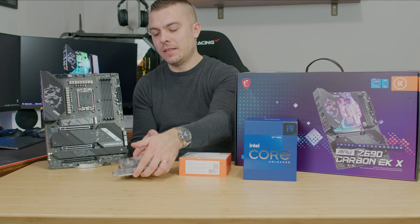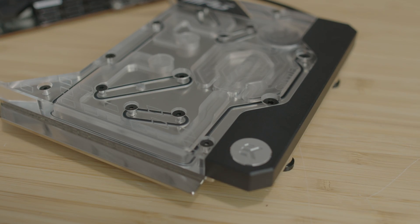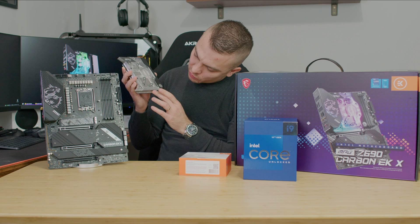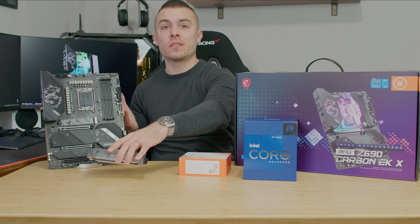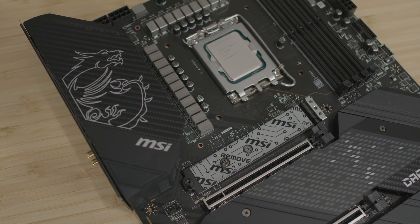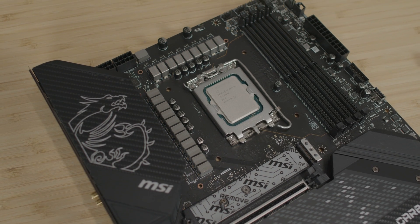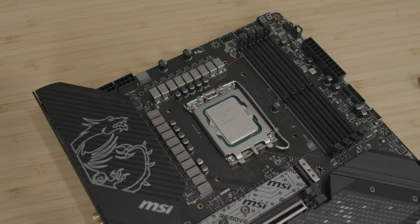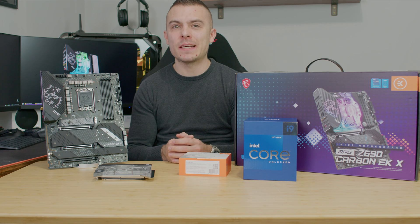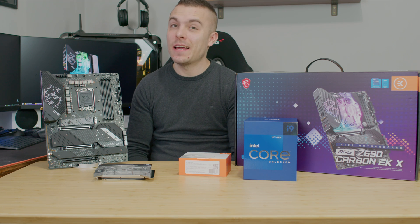The monoblock is quite huge, which isn't immediately logical. The first thing I noticed is this part at the bottom. While unboxing the motherboard I thought they forgot to place the top passive heatsink for the M.2 slot — then I realized that's why this part is sticking out. So you have liquid cooling on your top primary M.2 SSD, which is outstanding because it covers the VRMs, the processor, and the top M.2 SSD slot.